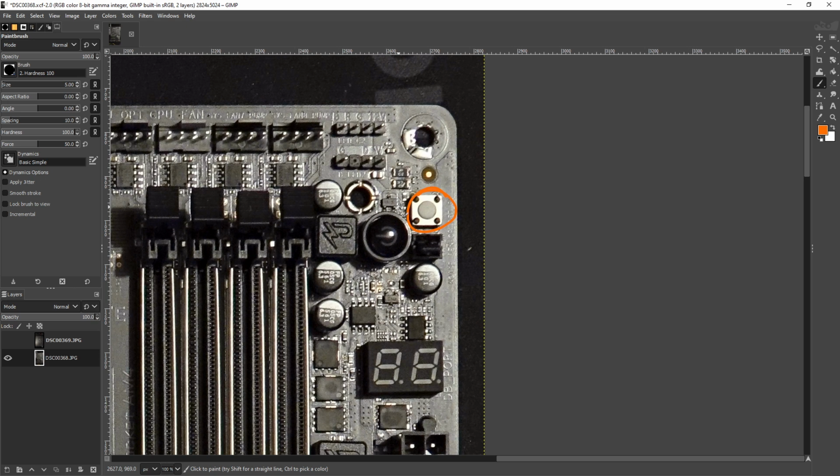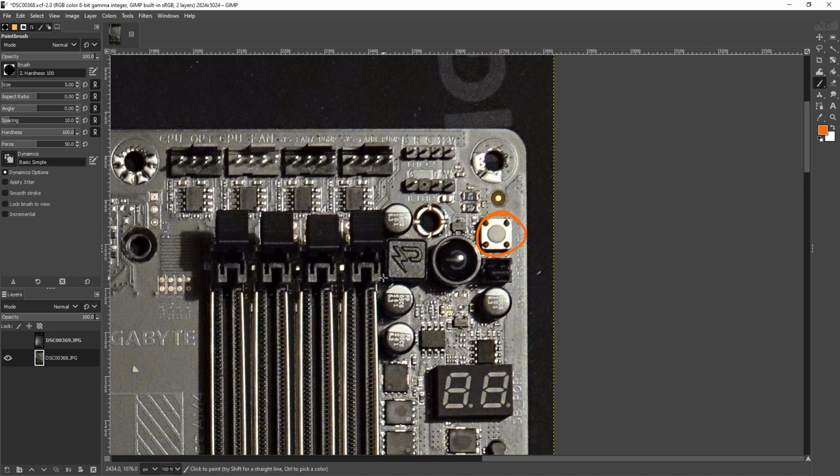And this is one thing that just frustrates me to no end with AMD motherboards. Also, when AMD puts out an AGESA update and the memory overclocking gets worse, that's also really, really fun to deal with. It's just like, this memory overclock used to work great, and then you update the BIOS and it doesn't work anymore because AMD did something to the memory training procedures.